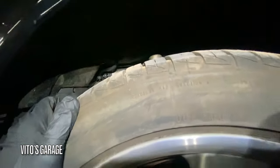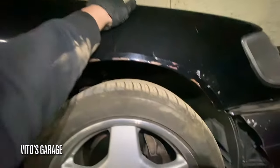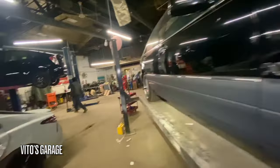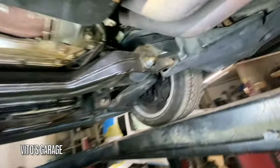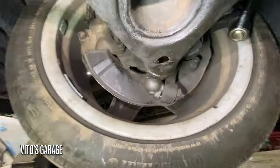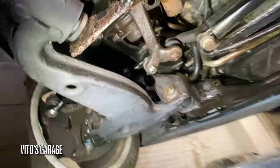While the car is on the floor, we're gonna start tightening all the suspension components. That nut right there is gonna get tightened, and the big bolt. We've bounced the car up and down as well. This side is done - we just finished tightening this bushing up top. We're gonna do that one on the other side too. Got everything secured while the weight is still on the wheels. Put a little bit of bearing grease on spots so they don't rust out. Everything's looking super good here.